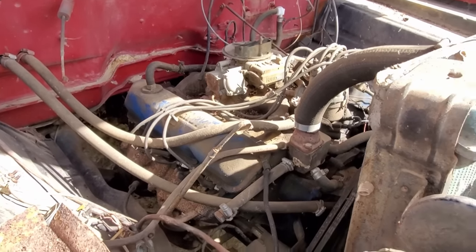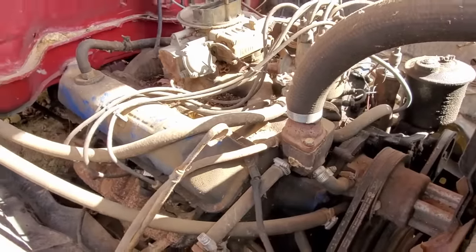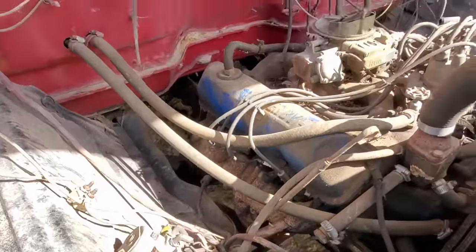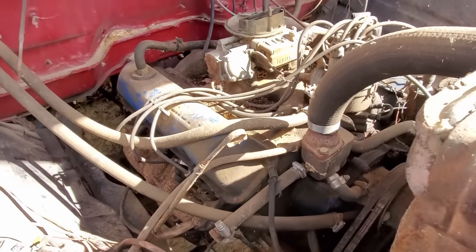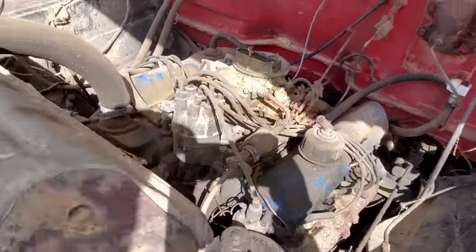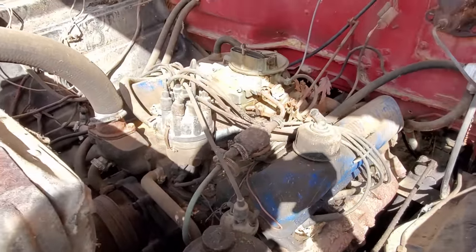There's some different things, and I can tell right now, water pump's different, water neck is different. That's about all I can tell right now. Exhaust manifolds look the same. The intake looks the same. You know, the intake comes up under the valve cover, like an FE. Yeah, it's probably a 360 or, you know, somewhere in there. As soon as I find out, I'll let y'all know.